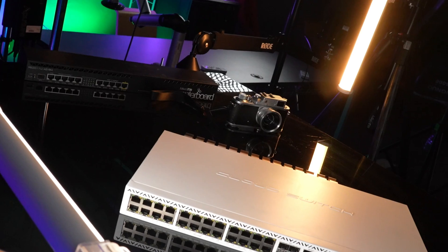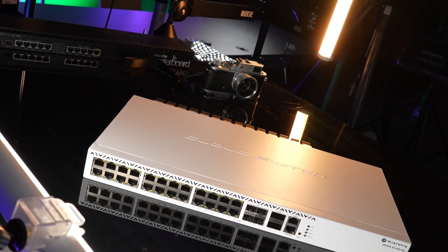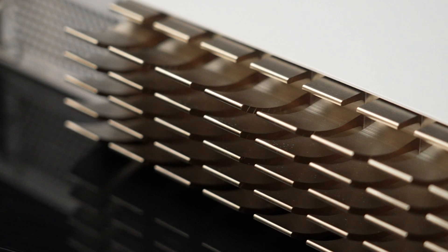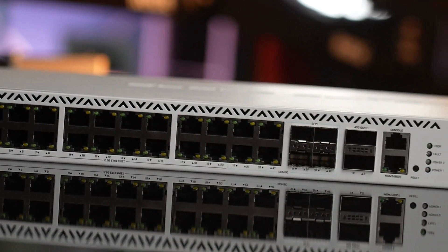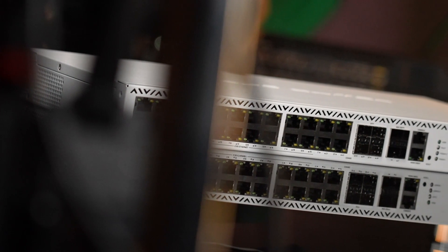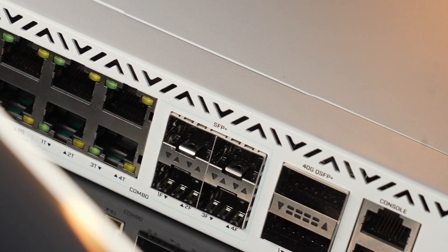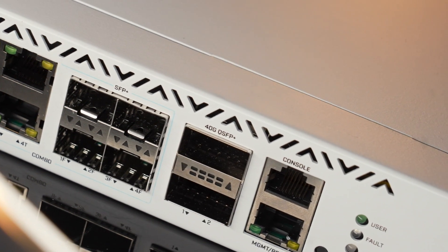Like many MikroTik devices, this one was born out of necessity. Our video team needed a fast, cost-effective solution that would enable them to connect all the studio devices without the need for a dedicated rack — just one switch and you are golden. They use the 2.5 gigabit ethernet ports to connect all the equipment: computers, extra screens, recorders, and so on. Then the four combo ports go to other departments in case they need to transfer some footage for review. One 40 gigabit line goes to the NAS media server and another 40 gigabit line goes to the editor's multimedia station where all the magic happens.